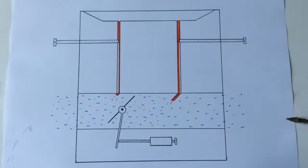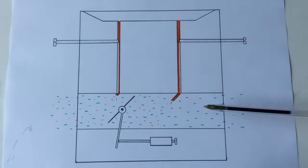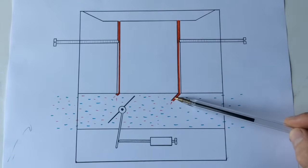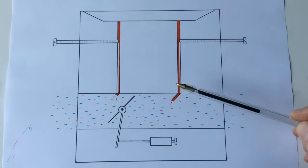There's more fuel coming through because we've turned this out, so more fuel's coming down there. And because it's on tick over there isn't large volumes of air being rushed through - the engine isn't working so fast and drawing air in so harshly - so it's not going to really draw much out of the main jet.